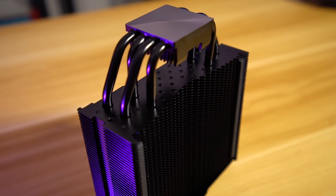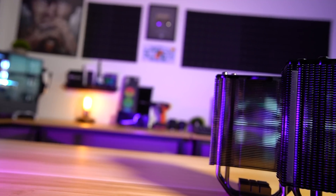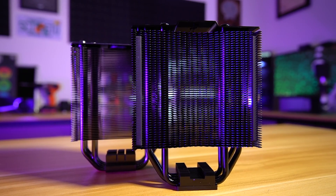The Dark Rock Slim is a new entrant, came out just a few weeks ago, and it follows a very similar footprint. Four copper heat pipes each, each come with a 120mm fan, both PWM fans. This one has a 180 watt TDP rating. The Hyper 212 doesn't have one listed, but we can assume it's around 160 watts TDP — that's what it comes out to in my testing, around the Cryorig H7 Quad Lumi space. I'm going to try to be as fair and unbiased as possible, especially given the price disparity. Maybe sound quality matters more to you than cooling, though at this price point you're probably more concerned with cooling.